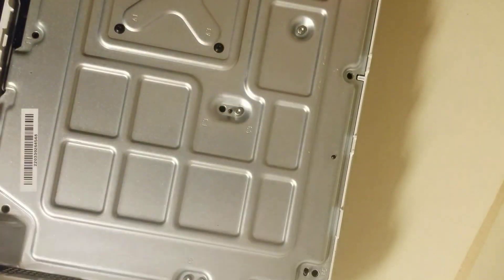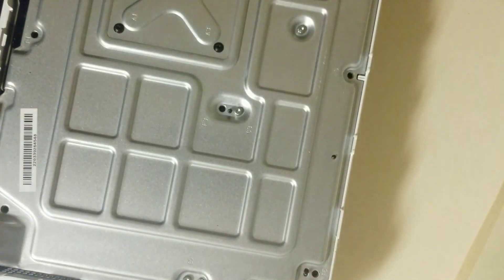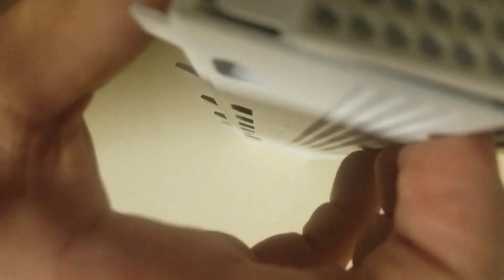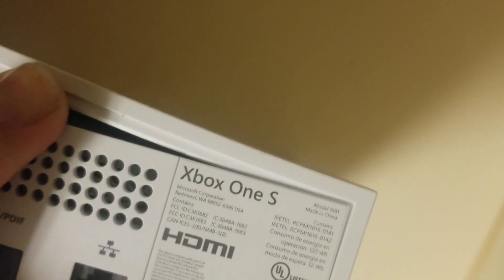When you're pulling the green screws, count six screws. I haven't worked on as many S's as I have originals. With anything that has a slot-loading drive, somebody's going to put two discs in it or shove something that doesn't belong in it — so that's usually your most common problem with Xbox Ones. They do have weak lasers, but I haven't seen a laser failure yet. I did have one come in where they damaged the laser — I think they took a knife to the drive after they got something stuck in it.